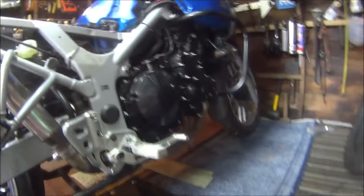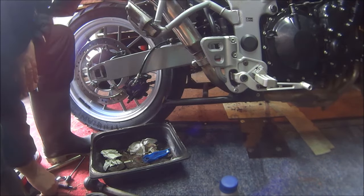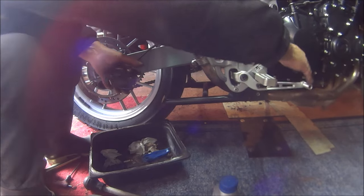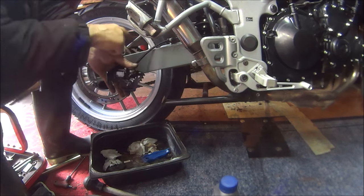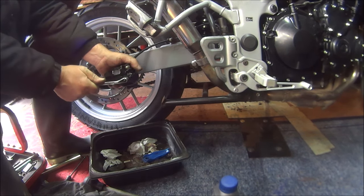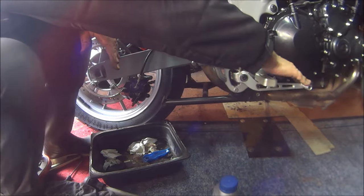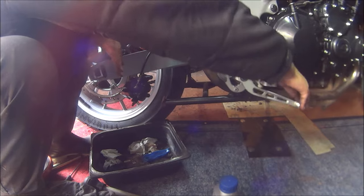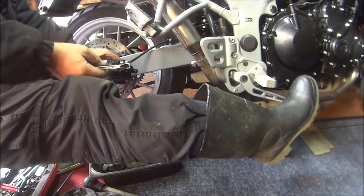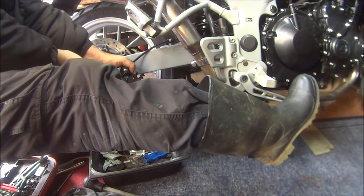So now I'm just gonna try and get the pressure back up by pumping the brake and opening the bleed screw. That'd be fun, wouldn't it? We'll take this bracket off as well so the pipe's more free, but that bolt's not having it. I can't hear any air bursting out. Looks like I'm going to have to keep the brake pedal down, so try and reach with my foot, press the brake down, try and undo the nipple. Oh, that's better. Got a bit more of a spurt.